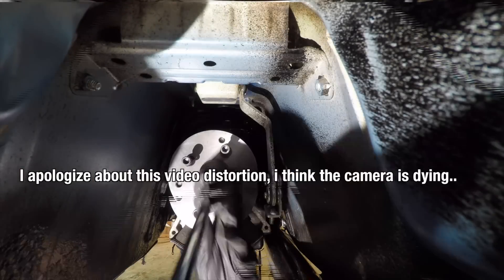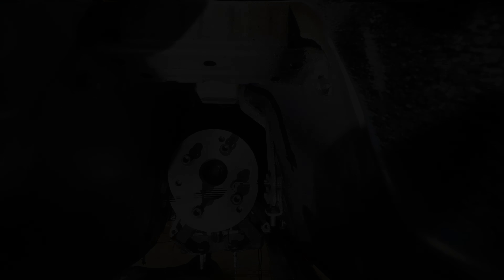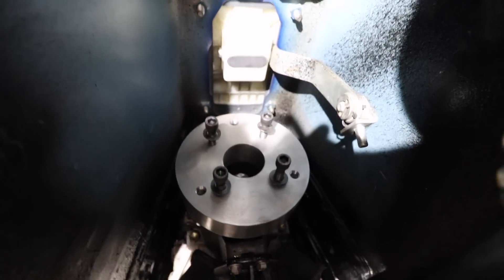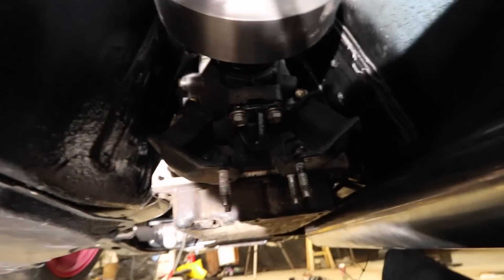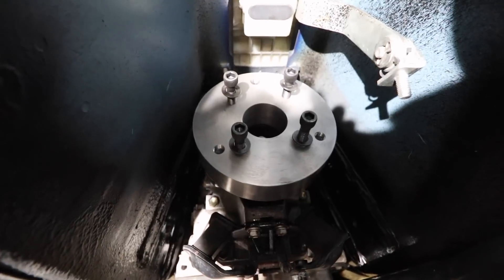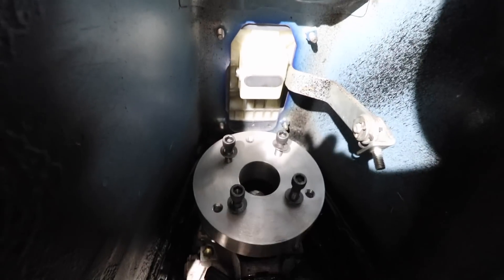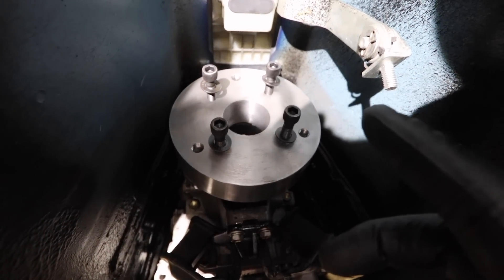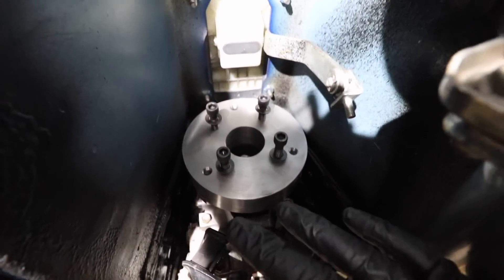The driveline adapter install was simple, all thrown in there. I was going to bolt up the rest of the driveline, but the shifter linkage in the top right is going to get in the way of that work, and the exhaust is also getting in the way of the transmission mount area. I think all the fabrication needs to be done with as little stuff on as possible, so I'm taking a break from installing the driveline and going to focus on building the shifter linkage and then the transmission mount first.